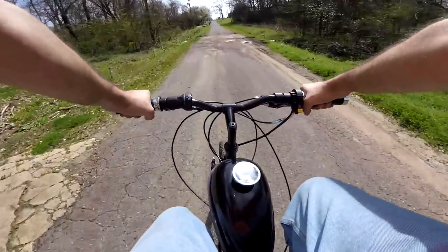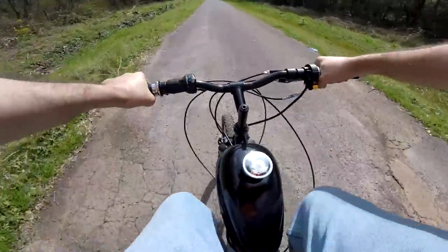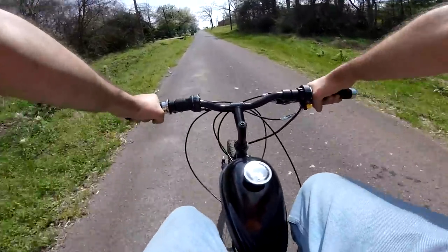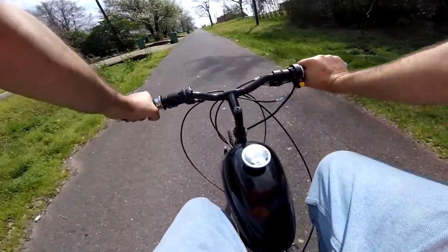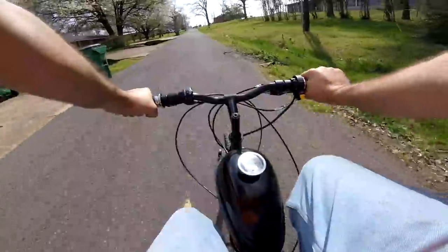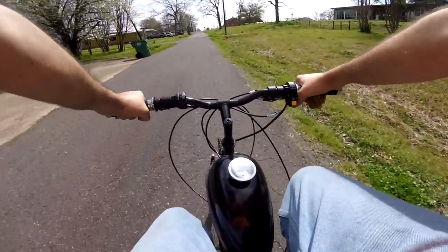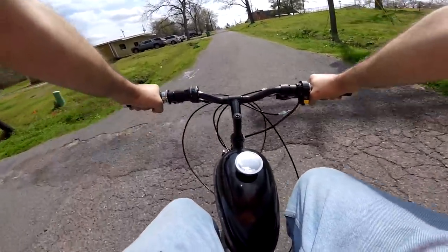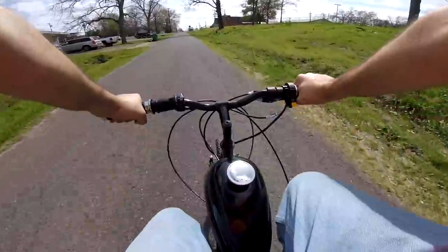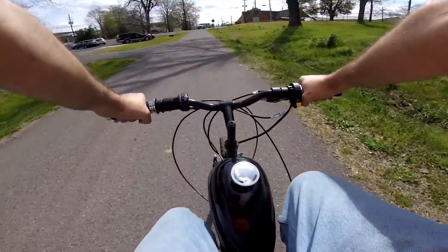And that didn't work, of course. That immediately just slipped right through. So I could not use the clamp-on hub adapter on this bike. All my attempts to prevent it from slipping and bending the spokes, which it was doing quite severely, were just leading to more damage done to a hub on a brand new rim. I'll be replacing this rear wheel with a heavy-duty one, probably one designed specifically for motorized bikes where you can just bolt the sprocket right onto the rim.